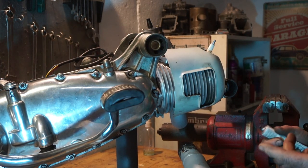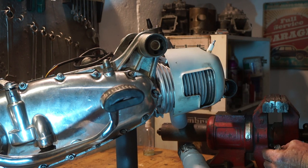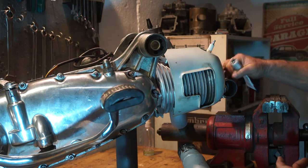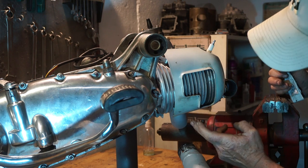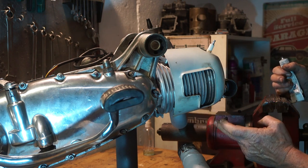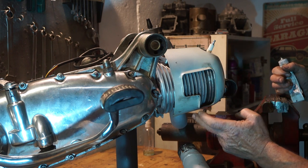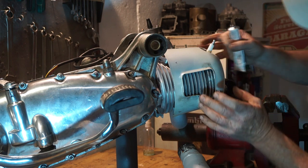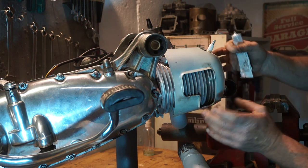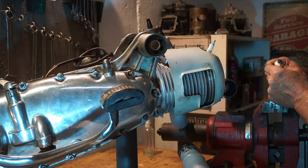The first thing we're going to do is put some air sealant around the exhaust. We've already put the down pipe on. Don't cut away the cowling when fitting your down pipe to make it easier to get to the nuts, because that's just allowing more air to escape from your exhaust cowling and not cooling your barrel. Always pull the shroud forward, put the nuts on, slide it back and fit it. So we're going to put some sealant in here now.